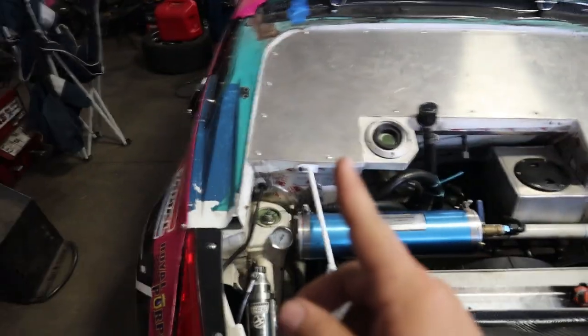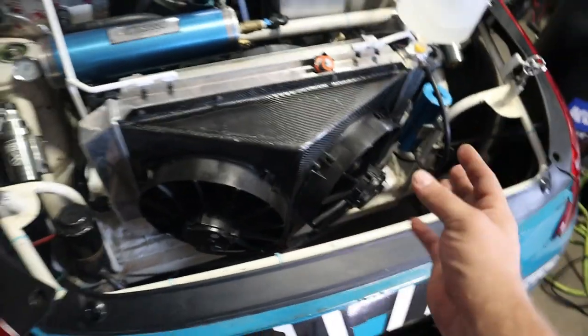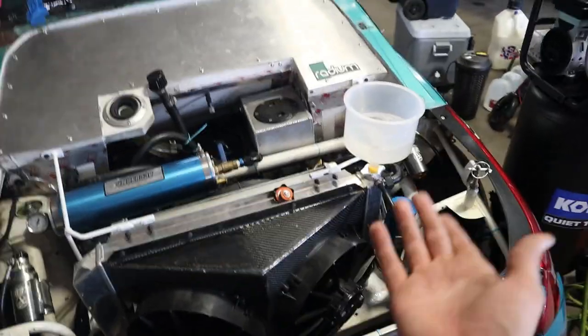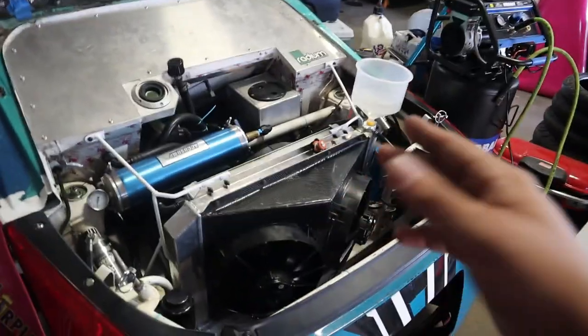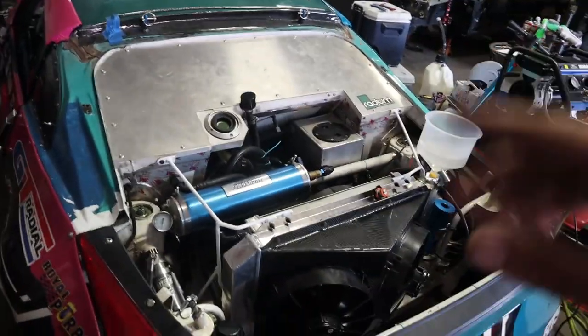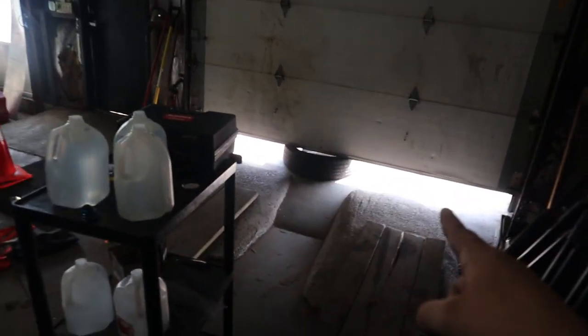I'm going to let it run for a while. I did have to shut it off because it got hot again, but it was perfectly fine. Got up to 175 degrees, the fans were blowing cold air. The radiator wasn't even hot and it started to bubble at about 195 or so — I let it run up to 205. This water is still ice cold. So I'm just going to do this a few times. We did get air bubbles coming out. Something to note — it is an ethanol car, but no matter what car you're working on, always make sure you have proper airflow. We have a fan up there that pulls nice air out. The engine is reading 205 to 210 and all these lines are still ice cold, so it's not actually flowing all the way yet.